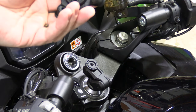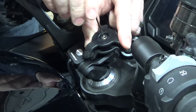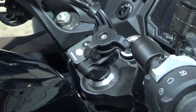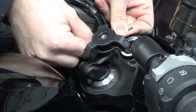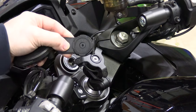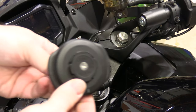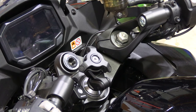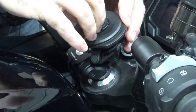So this is your vibration dampener — it's got a bolt inside. You'll just line it up into the teeth, stick your allen key through the hole and tighten it down. This thing counteracts the vibrations of your motorcycle. If you're not putting a wireless charging head, now would be the time you would put the Quad Lock mount on. But since I'm doing a wireless charging head, my wireless charging head has this nickel-plated bolt. I'm going to change it out with the extra black bolt that came with the Pro mount, just because of the looks. Fasten it down.